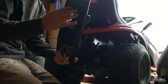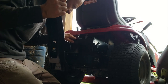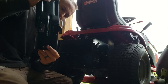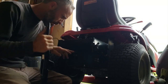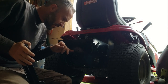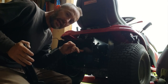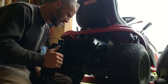The next step is to put this device on. You can see it's got these hooks right here — it hooks right into there. It says A, B, and C. I'm going to line the bottom center hole up with one of these. According to the instructions, you put it on A for a 38-inch deck, B for a 42-inch deck, and C for a 46-inch deck. I have the 46-inch deck, so I'm going to line it up with C.